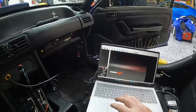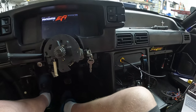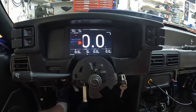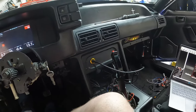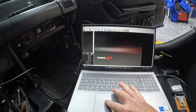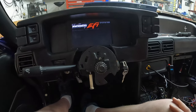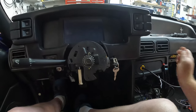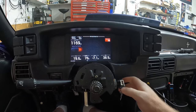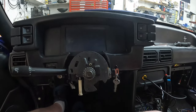We're not online so we're going to go ahead and key off, then key back on. The screen should come on — and it did. Let's go online with our tune — you can see we're online, ECU time is synced. We're going to go offline and cycle the ignition one more time, and this time we're going to fire it just to make sure it runs. We've got it in park, put on the brake, fire it up — and it fired right up. I'm not going to let it run for very long, but I'd say we are successful — we are good to go.